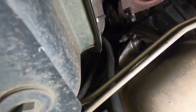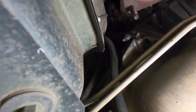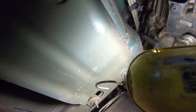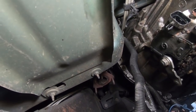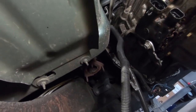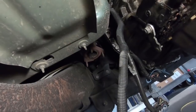Now we're on to two more things before we can take the transmission bolts out. The transmission bolts themselves are 15 millimeter. Up about in the middle of your screen there is a 13 millimeter that holds the dipstick tube in place — we need to take that 13 off. And there's also a 13 on the other side. Where all the fuel lines run in, there's a 13 up there as well. You're going to need a pretty long extension and probably a swivel to get to those. Once I get those out, the wiring harness will be loose, the trans dipstick tube will be loose, and the only thing left is to pull the actual transmission lines out.